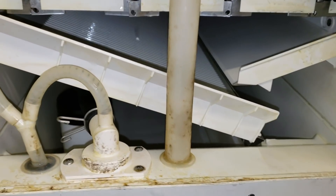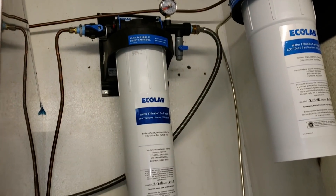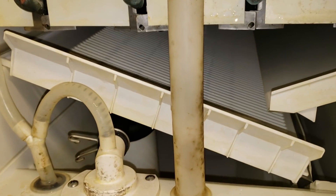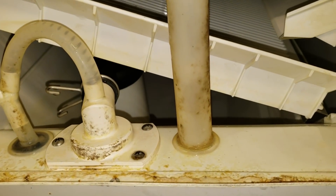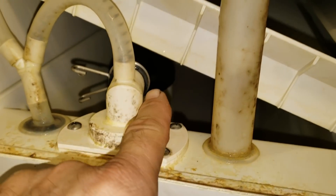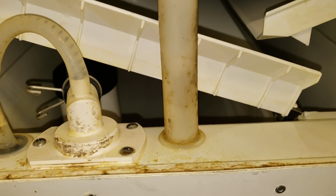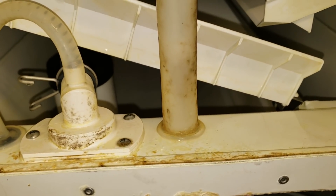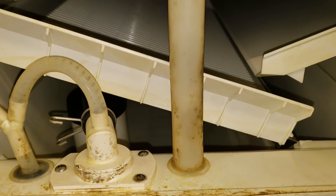Okay, we're all clean now. Because when I first walked up I saw that water filter go down into the red when the machine was filling, I'm going to time the fill. This is a five-gallon sump on this particular model — you have to pay attention to your model. I'm going to start my stopwatch, and the moment that water overflows through the overflow down there and starts coming out the drain is when we've hit five gallons. By timing it, I'm able to see the gallons per minute at which this machine is filling. I'll start right now and show you guys the results.